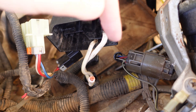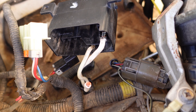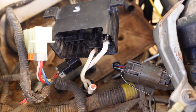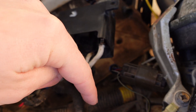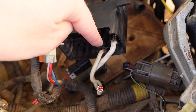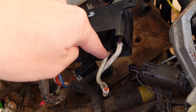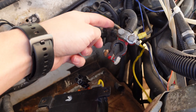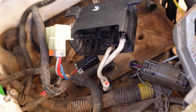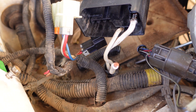The alternator wire is fused because if you accidentally ground the alternator, it protects the circuit. This is typically an 80 amp fuse, but if you run a bigger alternator you may want a bigger fuse — and this kit will allow you to do that because they are modern MIDI fuses, not fusible links. We're going to use one positive cable and the alternator cable; the third duplicate wire will be clipped, folded over, and wrapped in heat shrink and electrical tape so it doesn't ground out. You could trace back through the harness and remove it entirely, but that means taking apart the entire main engine harness.